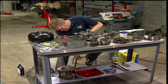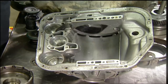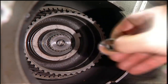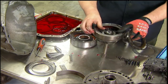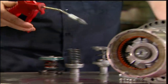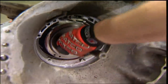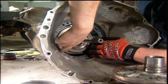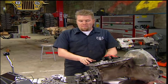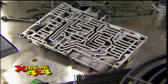Except the clutch discs are made of a different material — they're designed to handle higher heat and more aggressive shifting than a stock piece. Before you install these, you want to soak them in some tranny fluid. We start with the sprag clutch, making sure to install it in the correct direction. We'll use Vaseline to hold the transmission parts — never any grease. Then the low reverse band, planetary gear sets, and the output shaft. Install the snap ring and the thrust washer. Then the clutches can be rebuilt after soaking the new frictions in transmission fluid. After assembly, the clearance should be checked. To be sure the seals are installed correctly, you need to air check the clutch packs using some compressed air. Then put it all together — don't forget the gasket between the pump and the housing, as alignment of this part is critical. All we have now is the accumulator pistons and the band apply pins — adjust them according to the manual, and then we can drop the valve body in place. When you put the valve body together, use some Vaseline to hold the check balls in place, and the Vaseline will dissipate with the heat of the transmission fluid.